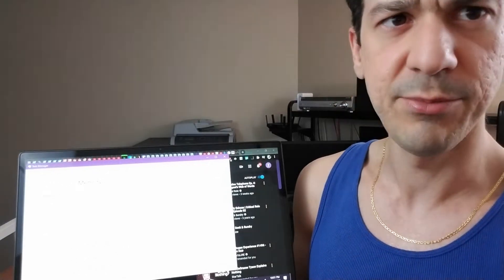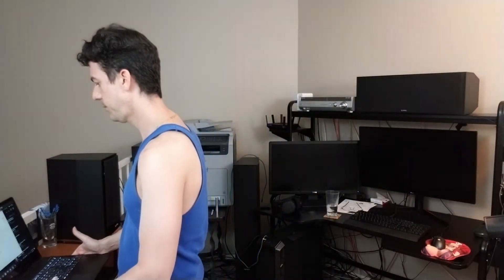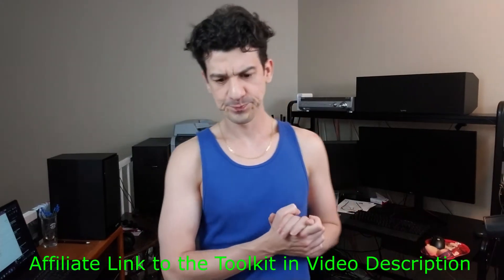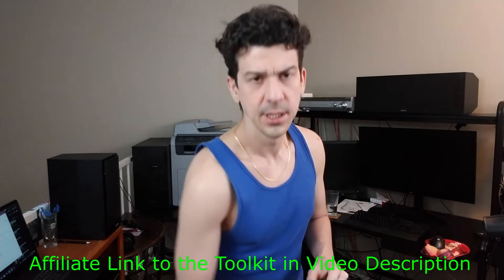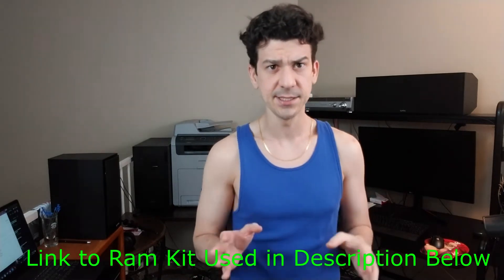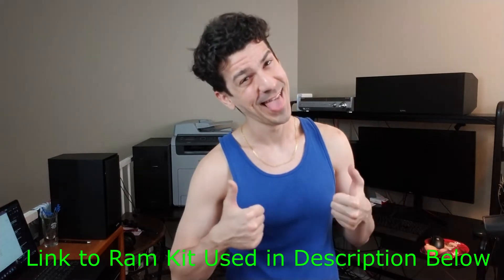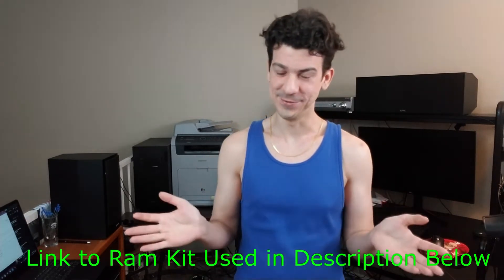It was pretty easy to take this apart with those inexpensive extra tools. Just make sure you go into the BIOS after you replace your RAM and verify it's being recognized, then save and exit — that's a crucial step for Crucial RAM so that it's recognized and works out just fine.